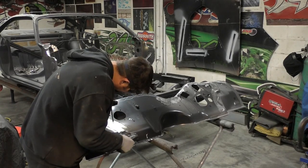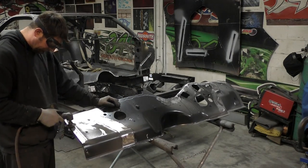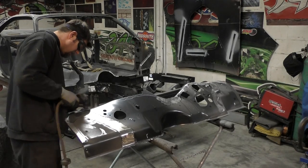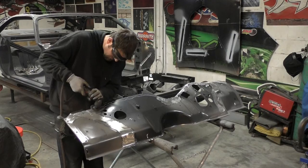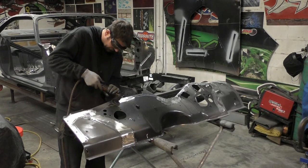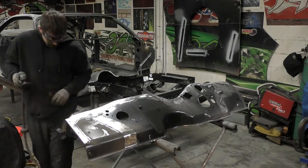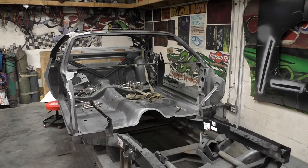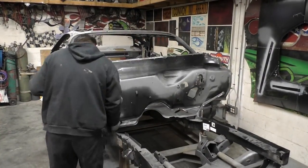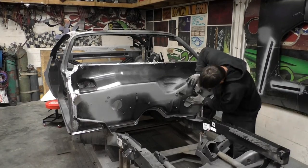If you're at home and you don't have a spot welder and you're MIG welding a lot of stuff, you're going to have to go through these areas that I'm cleaning up on bare metal, and you're going to have to do a 5/16" — 8mm — hole punch every inch, inch and a quarter. Those are going to be your rosette welds. I already had this panel test-fit on the car, marked where they're going to go, and then went back through to get ready to set up your holes.